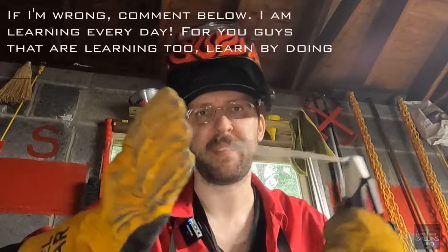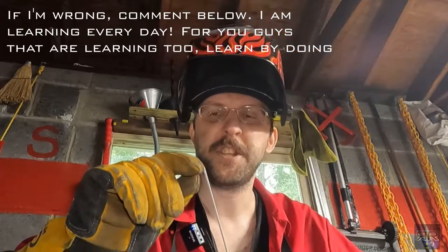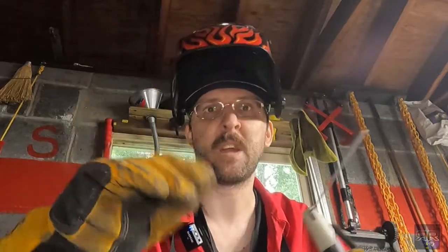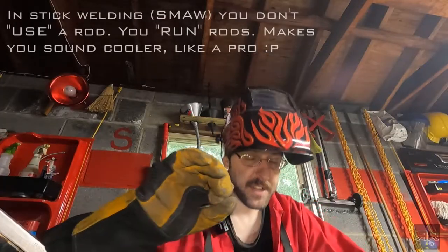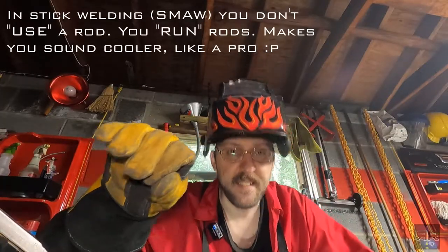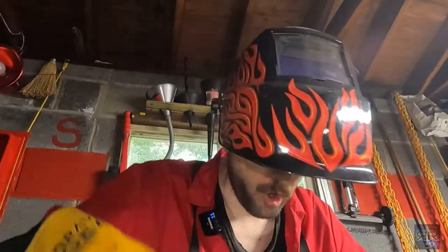What I've learned, it's a recap. I know I'm sticking a lot, but I'm kind of trading off a few things. Normally, when it sticks like that, it means you don't have enough amperage to melt the metal, especially at 6013. But I don't want to go too high in amperage, right? I'm at 60 right now, which is low, at least for these conditions, because then I burn holes because this thing is so rotted.